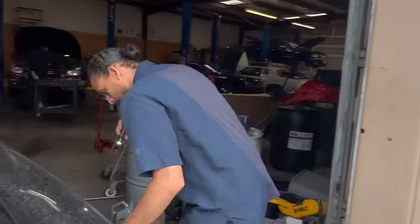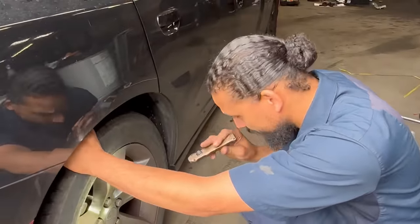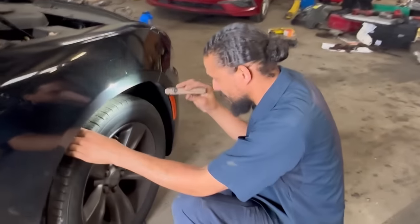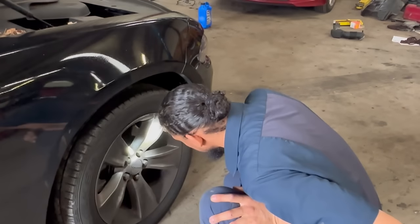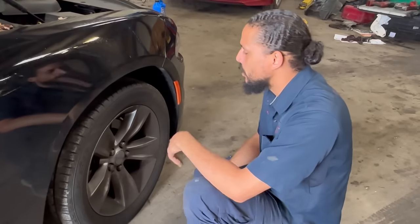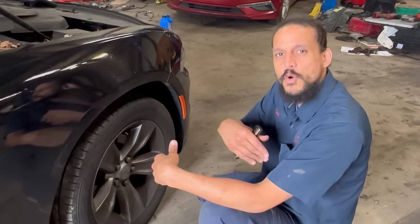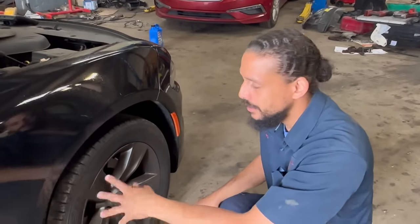Good tires in the rear. Another bald one on the other side — this thing is suffering from a tire problem. I'd recommend all four tires because this one is pretty much on the wear bar. Anytime someone does rotors, you really have to take a wire wheel to that spindle, otherwise they'll end up back in the same situation. A lot of people make the mistake of pulling off the old rotor, slapping the new one on, and expecting great things — and down the road they're back in the same spot.